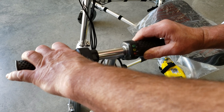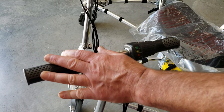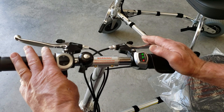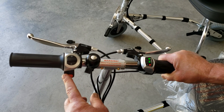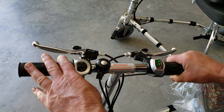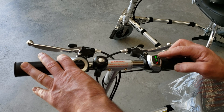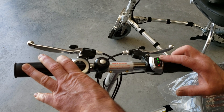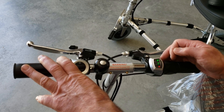You've got your twist grip throttle, just like you have on the predecessor model TravelScoot and the Shoppers as well. And then we are transitioning to slightly different controls — they appear the same. I'm going to remove this cramp buster very briefly. The on-off button is an oval red, and the forward and reverse are labeled forward, reverse — a little more intuitive perhaps. Same twist grip throttle, but the light indications are a little bit different. Instead of the yellow light, you have green, green, red. The proportions are still the same as on the green-yellow-red indicator — each one of these represents about one-third of the battery's charge, and that's essentially it. The function is identical.